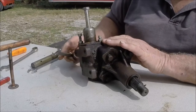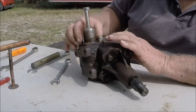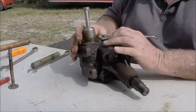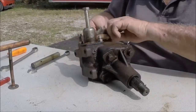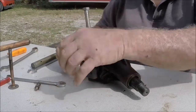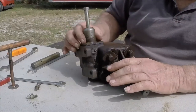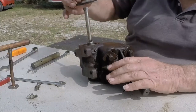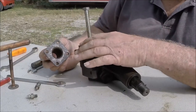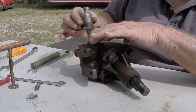When you pull this out of the car, you're going to have to unclamp the outer housing from this cap, and this is going to come out with the box. There are four screws to hold this cap on. This box has already been apart to make the video easier. So we'll take these screws out. I'm going to mark this cap so that you know how it came off — put a little center punch mark. Now you can slide this collar back up and off the shaft. You're going to find underneath there a gasket or a shim, and those shims are varying thicknesses from two thousandths up to twenty thousandths.